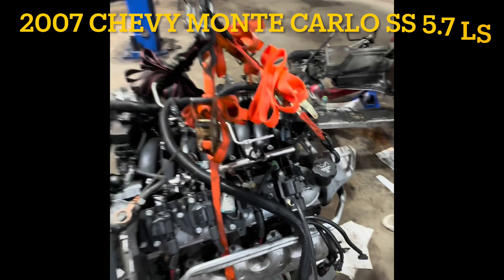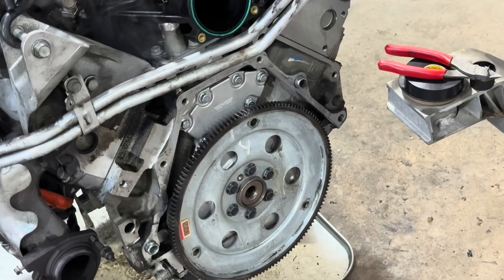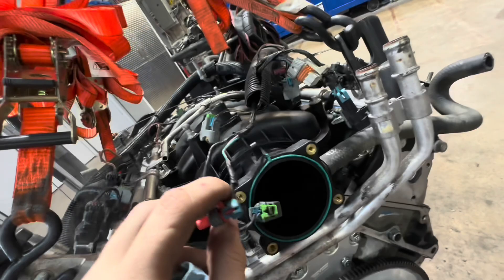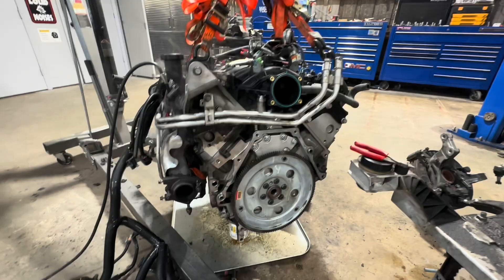There's metal in here — not looking good. When you're trying really hard to find an oil leak and can't find it, bust out the smoke machine. We're pumping smoke into the crankcase. Front crankshaft seal leak confirmed — look at that, smoking out of the crankcase. The reason for the engine-out mess is a very nasty leaking rear crankshaft seal, which has already been replaced. We finalized with the smoke machine and found an additional leak. While we were here, we decided to repair all the convolute shrouding the wiring harness. This engine is getting a full rewire harness and a reseal.